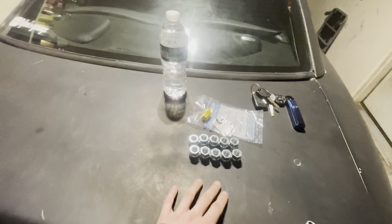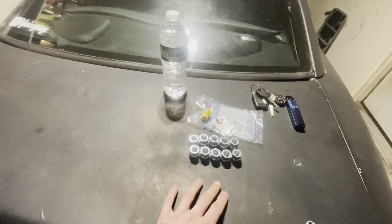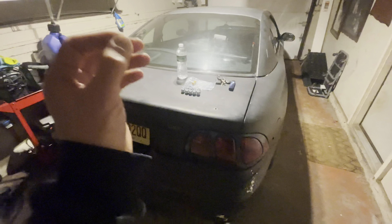For starters, I definitely want to get the front lug nuts on the car. This car has mismatched lug nuts on the whole entire car — some of them are locking, some are 21mm, some are 19s. We need to get proper lug nuts on the car. I have ARP studs for this car, so that is why I went with an open end lug nut. I'm going to need those for the track. I'll do them one at a time so I don't have to lift the front of the car.